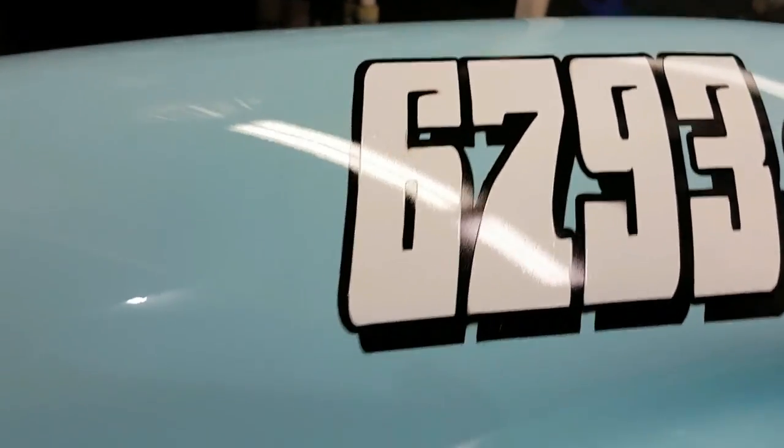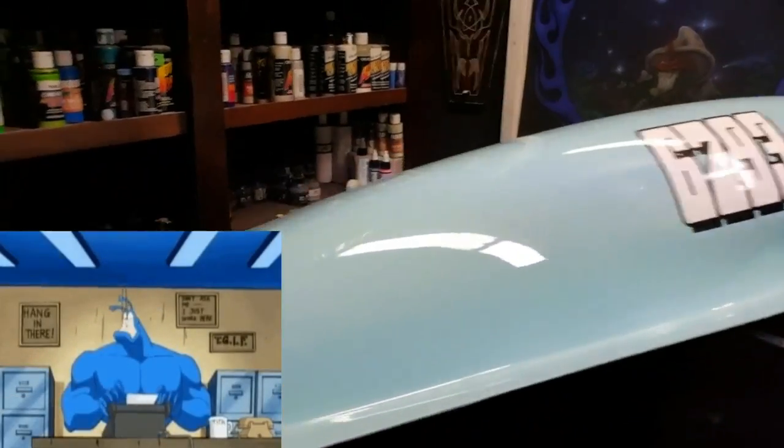And there you go. As always, let me know what you thought of the show. That's it for this one — I hope you guys learned a little something. Pretty simple, nothing too overly complicated: working with vinyl masks and one-shot paint. For those interested in how to take this off down the road — oven Easy Off. Spray a little bit on, let it sit for a minute, wipe it off. It will take off the one-shot paint without affecting the base paint. It might dull the clear a little bit, which is just a simple polish to bring that clear back up. Then you can slap on a brand new number and go racing in a brand new country.